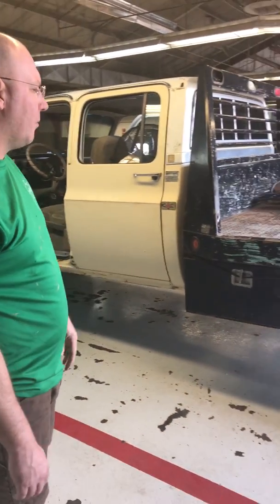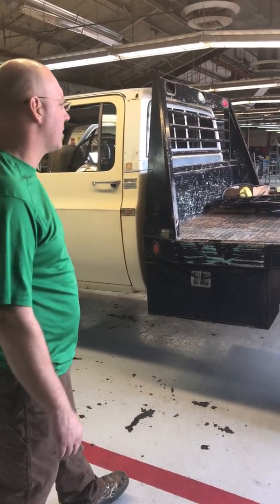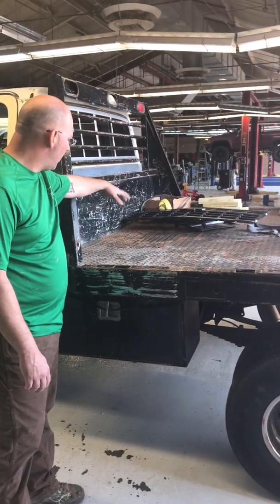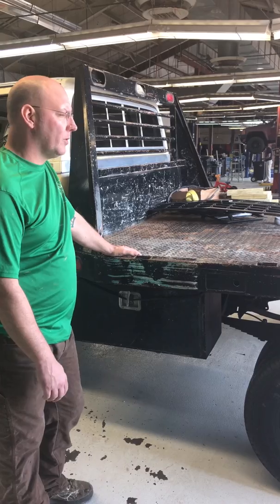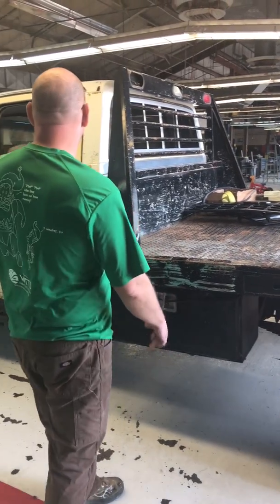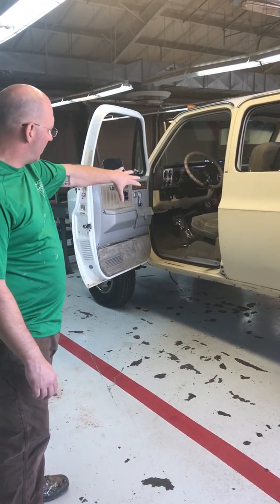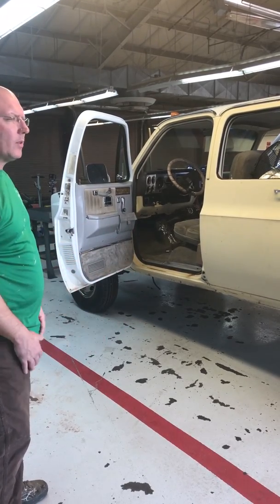This is held on with 8 bolts, so it's not going anywhere. It's rated for 30,000 pounds of towing. And I'm going to be mounting my fuel tank here, and I'll have my spare tire up here as well. So all in all, I'm going to have the room to do everything I wanted to do, be able to tow what I want to tow, and not have too many issues with engine clearance. I'm going to rebuild the cab area to clearance all that stuff, make a nice cover, make it look nice.